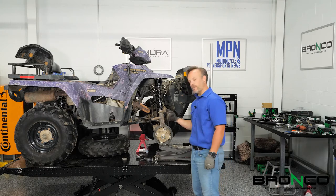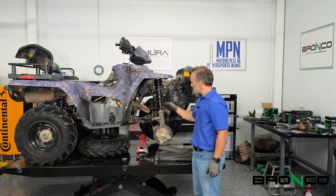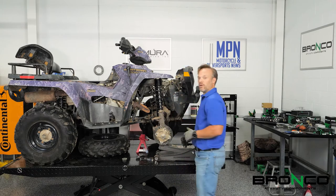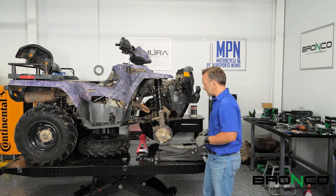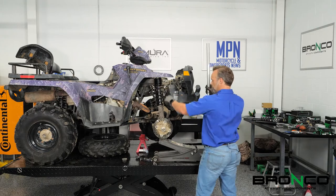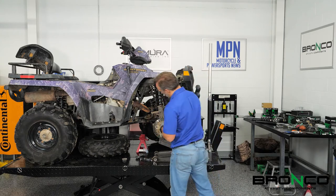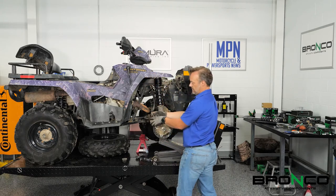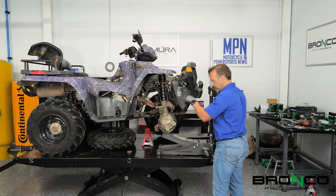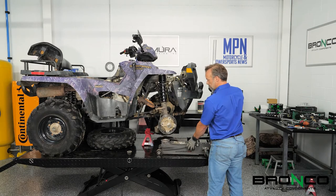Next up, I've got the floor jack here because we're going to put that preload into the suspension. Pretty much anywhere under the steering knuckle and ball joint area on the control arm — we're not putting a huge amount of pressure on it, but just enough to push the steering knuckle up over the strut. Down at the bottom there's a spot where you can either see or feel that the strut is all the way bottomed out before you go ahead and tighten anything down. Now that I feel it's all the way bottomed out, I can tighten these down. One thing to make sure: the brake line has a holder — make sure you put that on that top bolt. Now that we've got that tight, we should be able to lower the jack down.